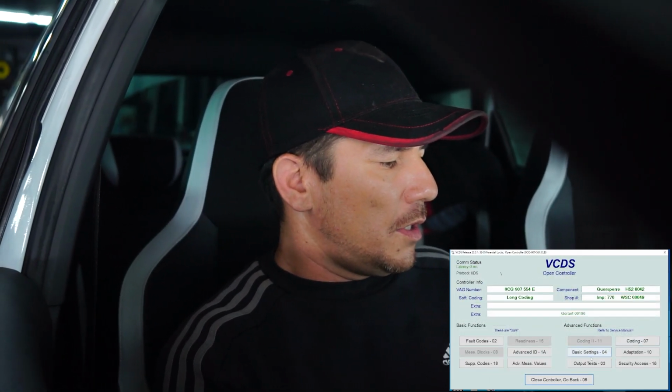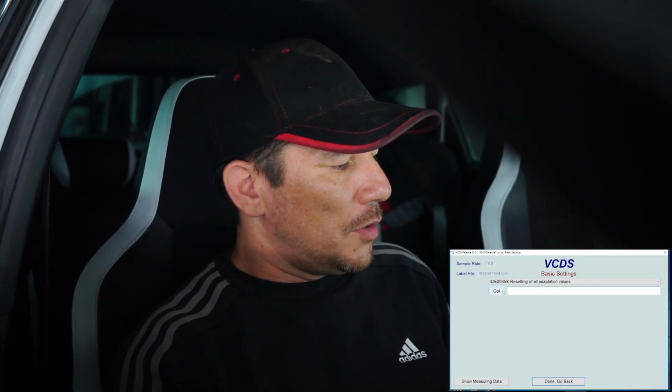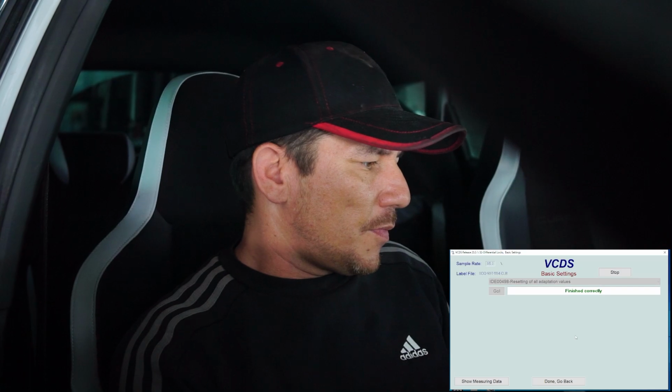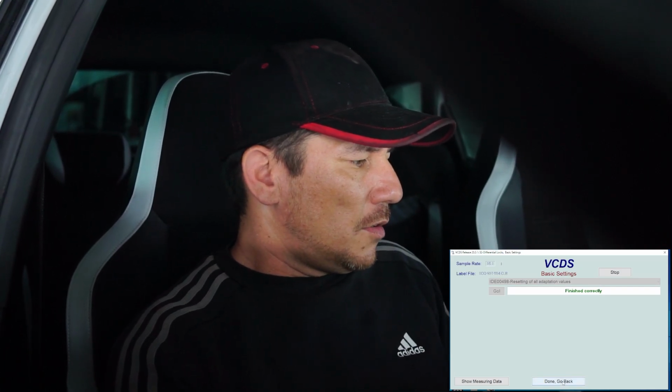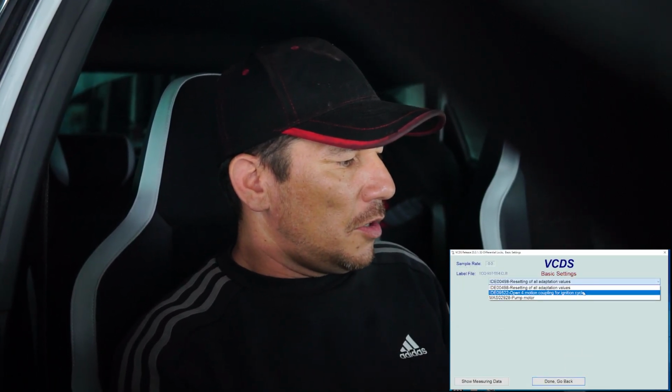Right, okay. So now that we're in here, what we're going to do is basic settings. I'm going to reset the adaptation values because we have just done the service. So we're going to go and readapt them, and that's finished correctly. So I'm just going to go done to go back again, and then I'm going to go back in on the basic settings, and then we're going to go to the pump motor setting there.